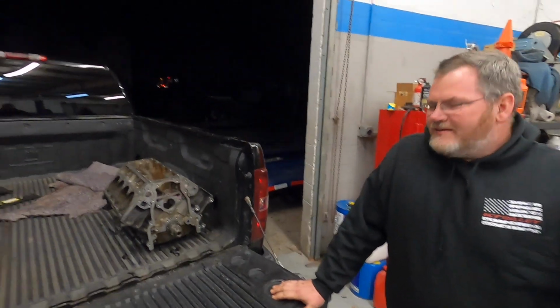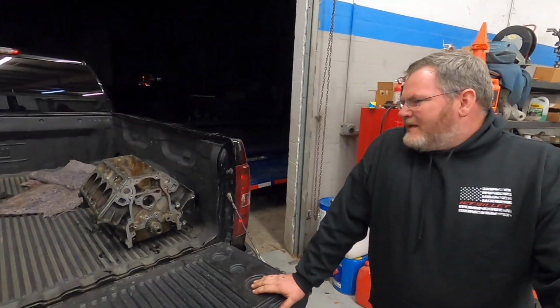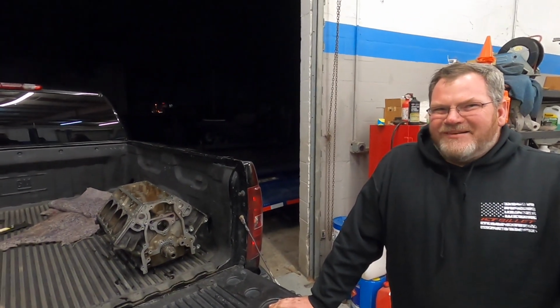It was a manual car, right? Yeah, so a manual's going to dyno a little higher and all that, but dude, 750 at 200,000 miles. We didn't do a regular cam in this. This had an LS9 cam. We could have made more power. I think we changed springs on it twice. Yeah, this was like an executive type car. You wanted to drive real power, but it had to be quiet.